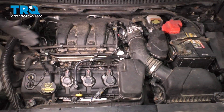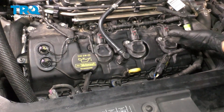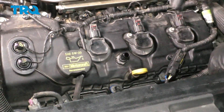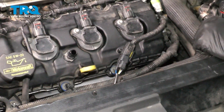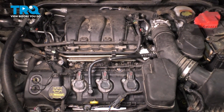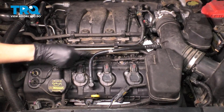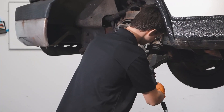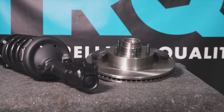If you had an engine cover you'd put it back on the grommets, but ours is missing. At this point you can do the same to the front bank — the only difference is you'll have to pry on the locking tab to get that hose off and possibly disconnect the wiring harness differently, but other than that the procedure is the same. Now because the valve cover was off, I strongly recommend an oil change. With the engine back together make sure it runs nice and smooth — you shouldn't have any vacuum leaks. If something is wrong, double check all your electrical connectors, fuel injectors, ignition coils, and other plugs. When only the best will do, demand TRQ — the only company that lets you view before you do.